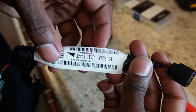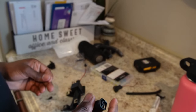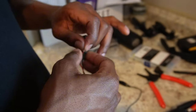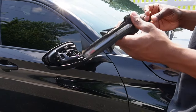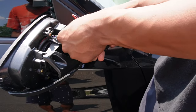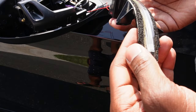If you want to buy this sub harness, this is the part number for it. That's the sub harness if you do go down the aftermarket mirror route like I did. Now let's test it on the car first. If you're using these aftermarket mirrors, as you can see these are flipped, so I basically have to put the positive here where the negative is and the negative where the positive is — so let's switch it around: red into black, black into red. There we go, it's working. Like I said, these are wired weird on this car, but that's how it works.